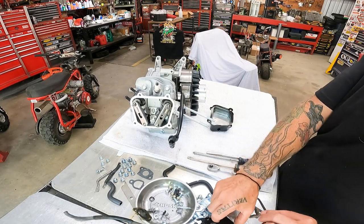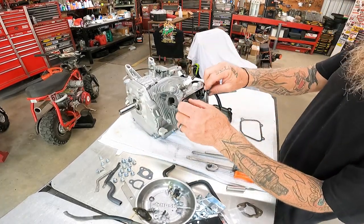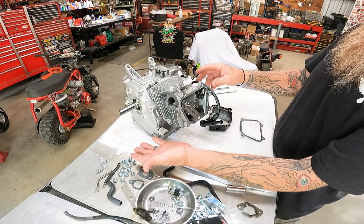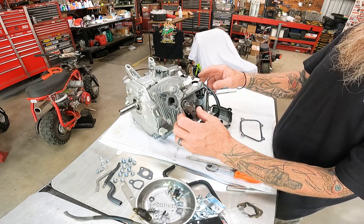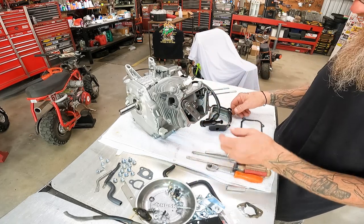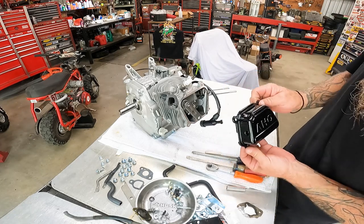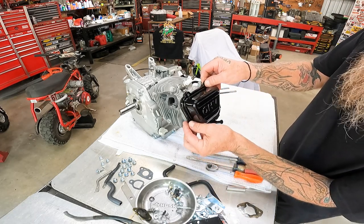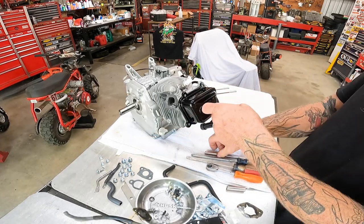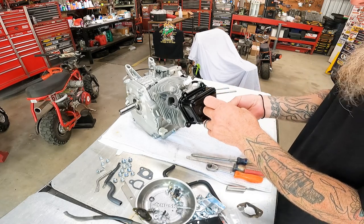Let's go ahead and get the valve cover put back on. I went ahead and put the push rods back in the motor. Since I didn't take the head or anything off, I just pulled the governor out since I did remove the cam and put it back in. I went ahead and double-checked the valve clearance — nothing should have moved and everything was totally fine, but I had it apart so figured might as well check it. I pulled the valve cover off to get it powder coated. The gasket was still good because the motor was new, so we're going to reuse it — could have copper-coated it but I think it'll be fine.